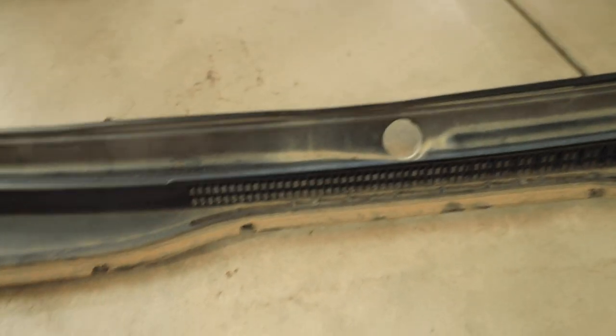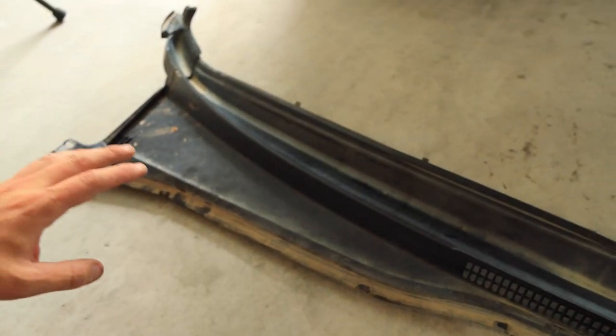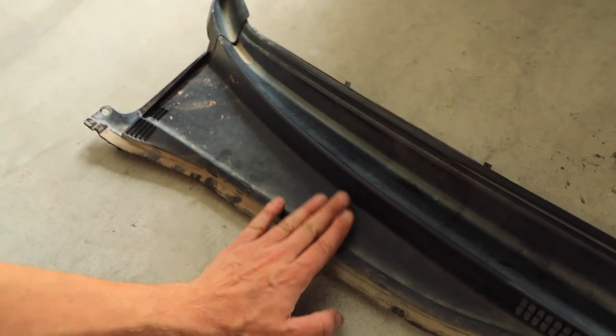Making progress, slowly making progress. And I wanted to show you about where this would be on the vehicle. So the area we're gonna be punching through is about right here. So you can see that there's not a whole lot of vents right above it. So I'm not too worried about water coming down and kind of splashing on top directly into where the intake now will be. What I may do is cut some more holes around it to allow airflow in, because right now the only vents that are in that cowl are purely for the HVAC system, air conditioner and heater for the cabin. So I may drill a few more holes in there, but I'm gonna try to keep that same principle where there's no direct area where water could go straight into the intake.